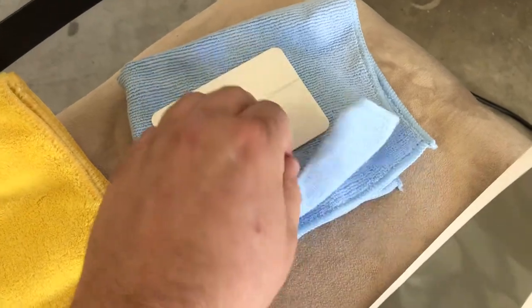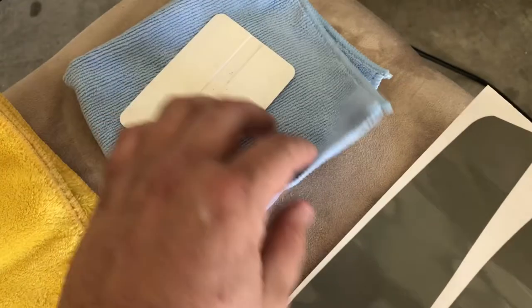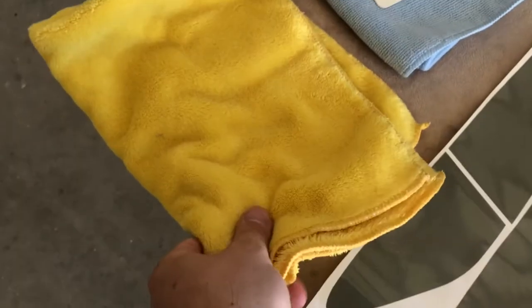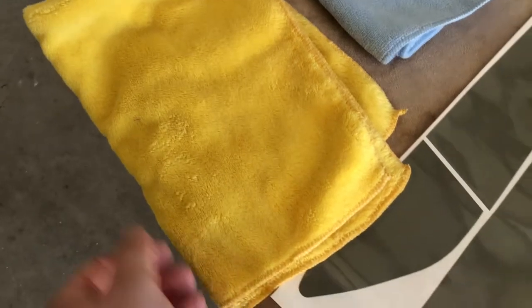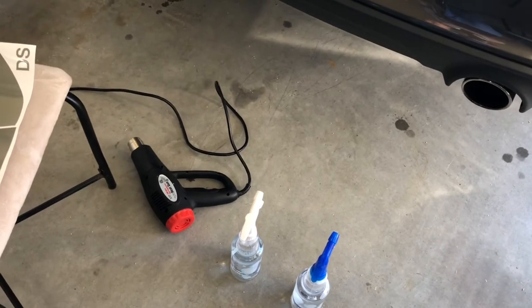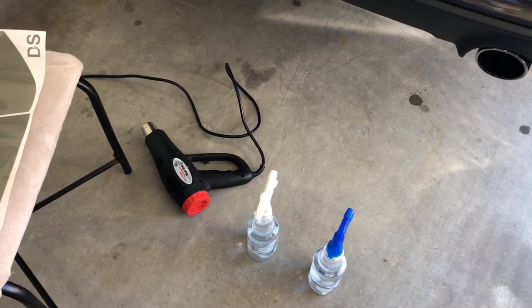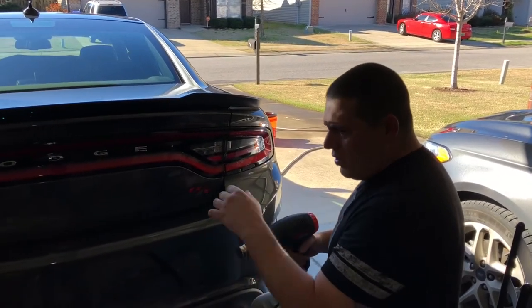This right here is the tools and things that I use. I use a squeegee — it's a hard squeegee — and I wrap the edge over this microfiber towel. If you've got a felt-tipped squeegee that's even better; I just don't happen to have one. I've got this cheap plush microfiber towel from AutoZone. I put my finger through it and use that to smooth the tint out. Then of course a heat gun — I usually just use that to lock it in at the end.